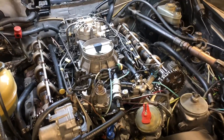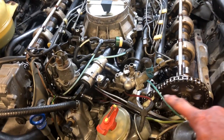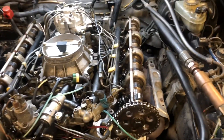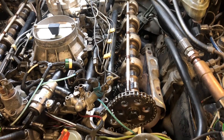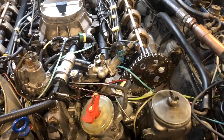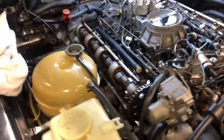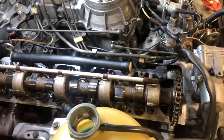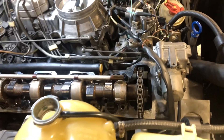I thought maybe a broken piece of guide had fallen down and was wedged somewhere, so I took off the valve cover and gasket again, disconnected fuel lines — took about five minutes. When we put it at top dead center, timing marks are perfect. So if it's not that side, we decided to look over here. This also took only about five minutes to take apart, and sure enough, the timing marks were dead on. When I'm at top dead center with the distributor, my timing marks are dead on. But then we noticed something.